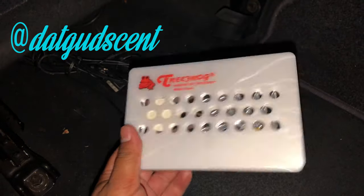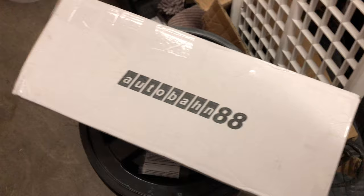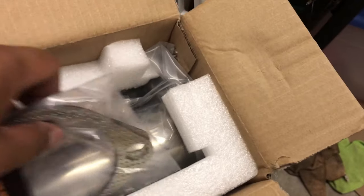Check out Stan's stuff — it smells so good in here. To get the EGT sensor out, you have to go underneath the seat. You just want to lift it up — it's a little plug right here. What you want to unplug is so that you can pull this piece of cable through right there, and cut it once you delete the cat. Take the four bolts off and you tilt it forward — that's it, easy peasy. And there's some gaskets just like on the Z's on this pipe.